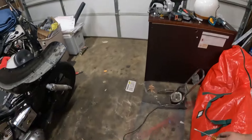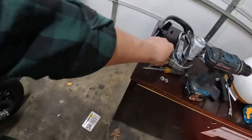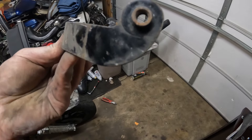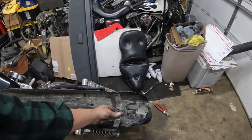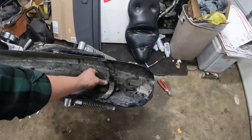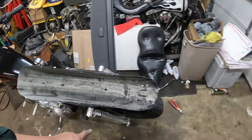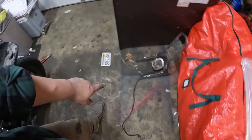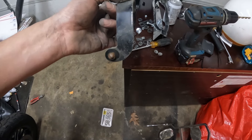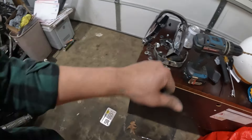I've been pretty brutal about ripping this thing down and going through it as quickly as possible. There's a bracket with a broken stud in it - I think I knew that was broken, but we'll get that patched up before we put it back in. This is the fender brace bracket that goes back here - it'll drop into each side of the fender. Here's your support bar, and then there's a bolt that goes through there. The taillight assembly can come all off together as one. You will not get the plug to clear the fender unless you pull this bracket. I got to drill and tap, try and fix that, and maybe just buy a new bushing.